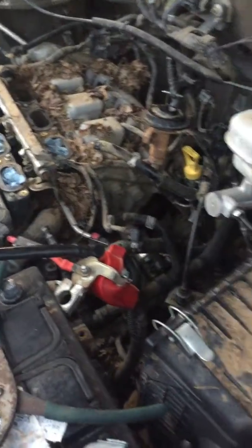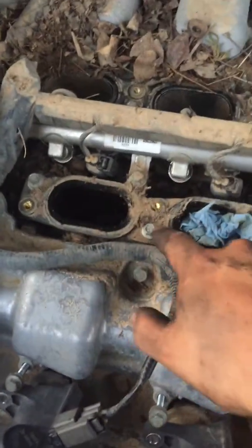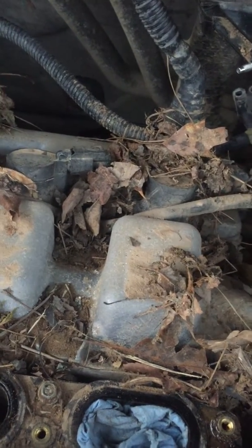We're still working on this 2008 Ford Escape. We got the throttle body and the intake off. It's pretty simple — you got 10mm or 5/16 bolts that hold the intake in place, a vacuum line, another vacuum line, the EGR valve, and the throttle body.